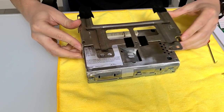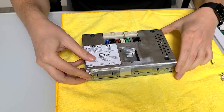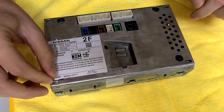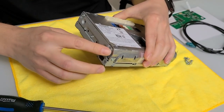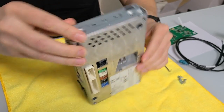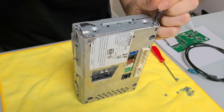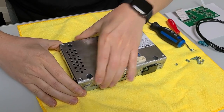When you're putting back this bracket, you're going to line it up so none of these connections get blocked. Now we're going to remove another four bolts from the actual back of the screen — one of them is under the sticker. There are two bolts on each side of the screen, so eight bolts total which we have to remove. With all the bolts removed, now you can separate the back of the screen from the actual screen.